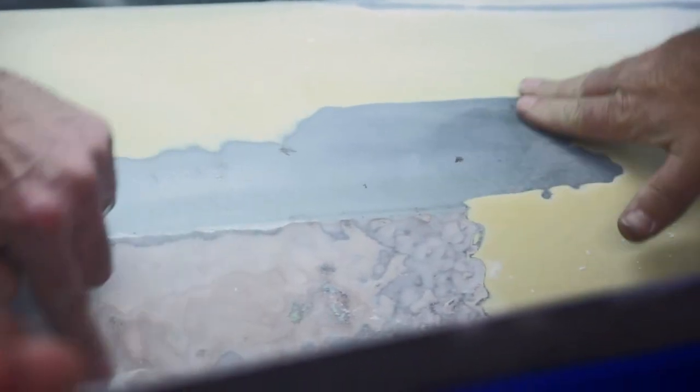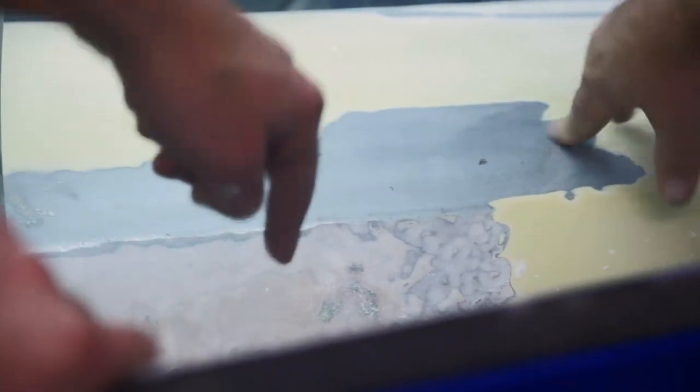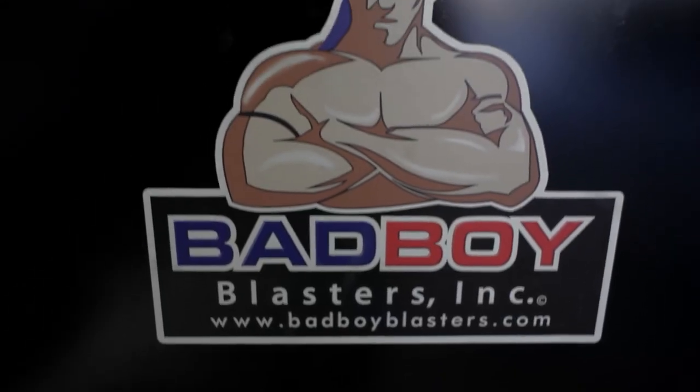We're using the DA to sand down the... Yeah, amazing. Your cars are high dollar, and they may look good on the outside. Right. But if that metal underneath is not prepared right... I agree. You have a bad job. See, with this, we don't have to have something dipped. I can just take that part, a door, and put it in there, clean it myself with the media, with the aluminum oxide, with soda, with whatever. And at the end of the day, I've just saved myself hundreds of dollars, and I controlled the destiny of that part. I mean, we blasted with that plastic media for what, half an hour? Did you ever have a plug up? It hasn't plugged one time on any media. That's where our blasters just blow them all out of the saddle.